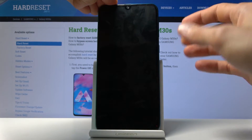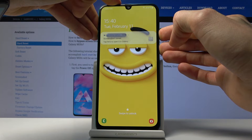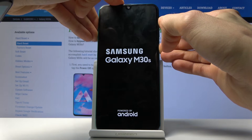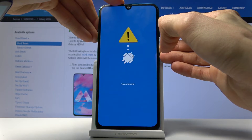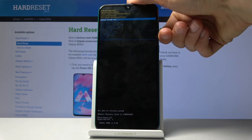So let's unlock it again. Power key and volume down — keep holding — and the moment it shuts off, which should be right about now, switch to volume up while holding the power key continuously. We're now in recovery mode.